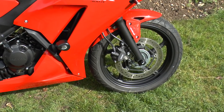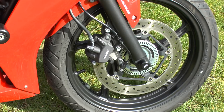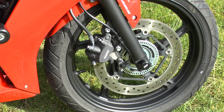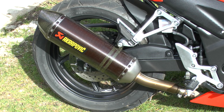Let's talk about the wheels. The front brake is a 296 millimetre single hydraulic disc with two-piston caliper and sintered metal pads. The rear brake is a 220 millimetre single hydraulic disc with single-piston caliper and resin mould pads — and it's got ABS, which is worth noting. Front suspension is a 37 millimetre telescopic fork with 130 millimetre stroke, and the rear is a monoshock damper pro-link swing arm with 170 millimetre travel.